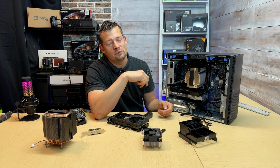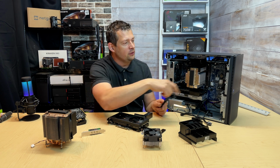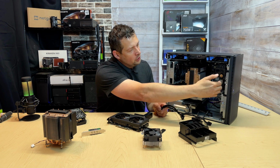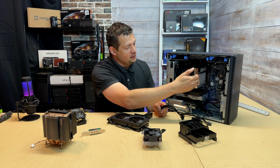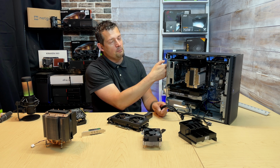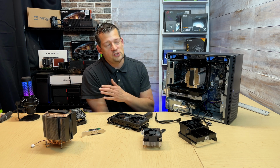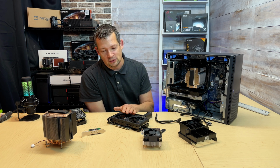Maybe Dell is keeping this for an Alienware and doesn't want you to have an extra fan, but using a wire splitter, you can have two fans. They're sucking all the cold air in, pushing it through your video card, pushing it to your CPU. As your CPU cooler temperature drops, it's also not unnecessarily warming up your video card, and this fan pulls everything out of the case. Significantly better airflow. It's super quiet. It doesn't introduce any noise whatsoever, but really helps with the performance.